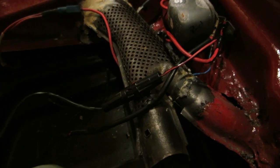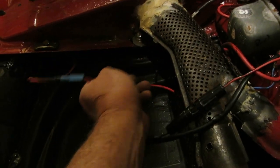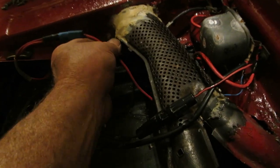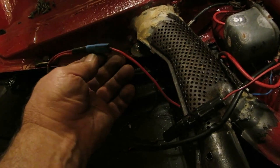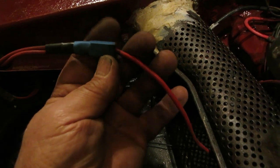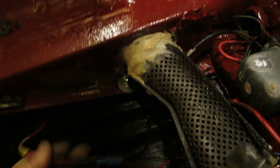Now, you've got some wires left over. What are they? Oh, I forgot. This one comes out of the wiring bundle up front. It's the thinner of the two wires, and it's the signal to your starter. I ended up having to clip that a little bit, but we put it in there, and I put some heat shrink around it, so it just ought to hold just marvelously. Lots of extra wire, so that's good.